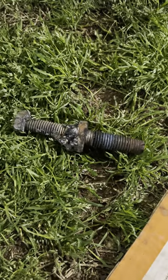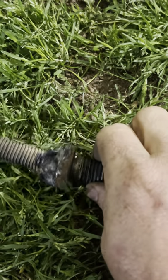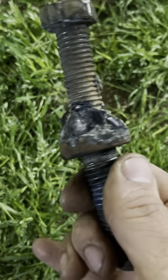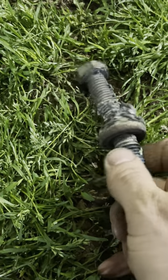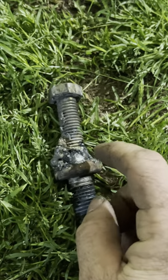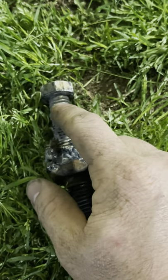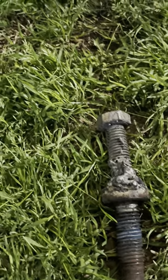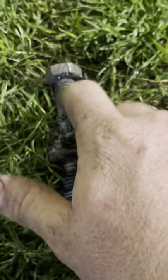What I am doing here — that is not an original bolt, as is evident by all this nasty weld on here. This is one of the most difficult metals I've had to weld to. I'm not a professional welder, but my welds typically turn out a lot nicer than that. This material was just extremely difficult to get a mild steel weld to take to. That's a grade 8, I believe, that I purchased at Tractor Supply. I wouldn't use anything lower than grade 5, because you might end up twisting it apart. Get a high-grade bolt.